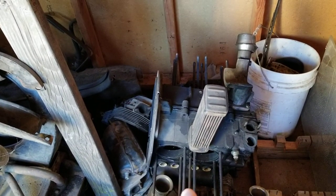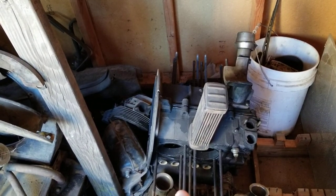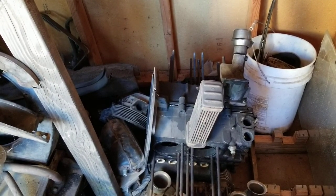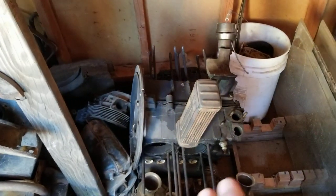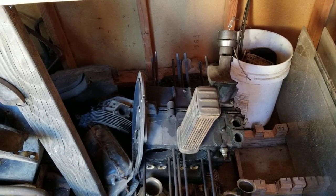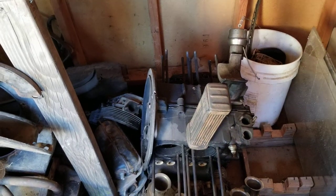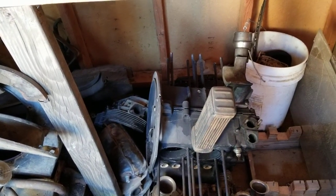But with the 76 or 78, there's not too much machining that needs to be done to the case. You can do that and be pretty bulletproof as long as you're not powering up the rest of the engine. Now, if you're starting to put major carburation on it, then you're talking about more case stress. Like I said, if you're going to be putting 48s on it, stuff like that, then you've got to follow another rule and go to that aluminum case.